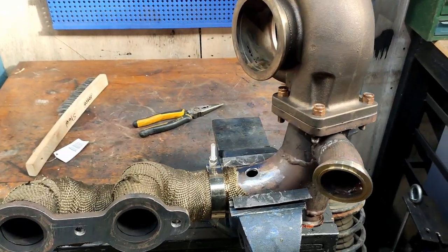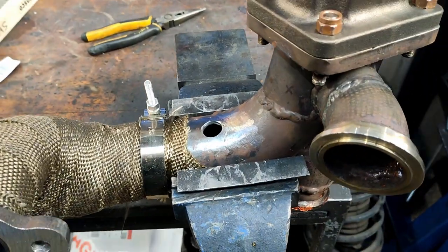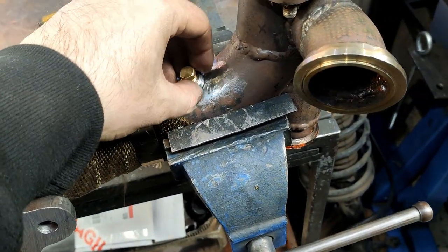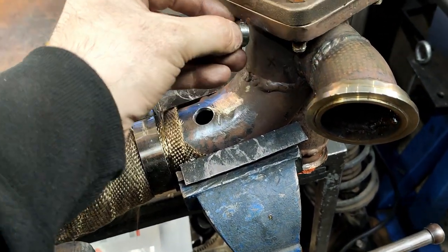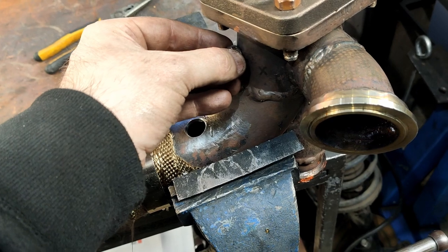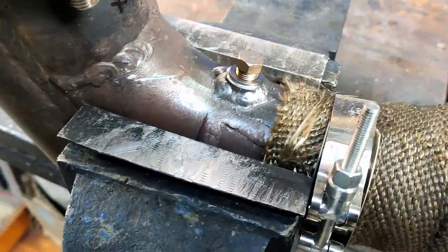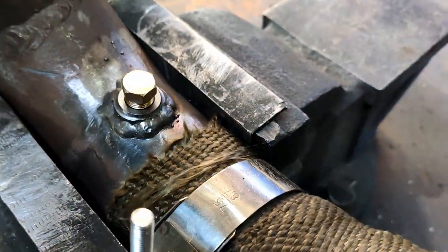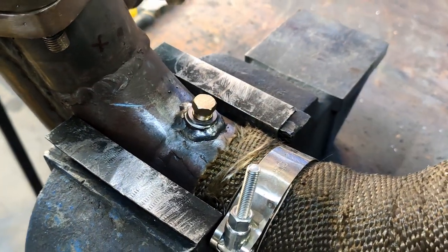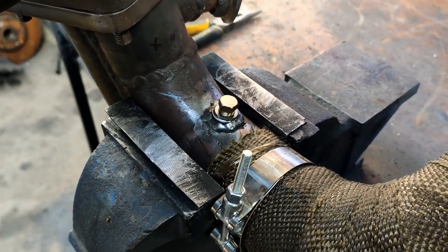One of the problems with having smarty-pants friends is they want me to put sensors in everything and get data for reasons. I'm going to drill a couple of holes in here while I've got it apart — I don't have all the sensors yet, but this will be manifold pressure, and I'll have another one here for EGT. I only need one because I can't trim banks individually, so just the one to see pre-turbo. Job done. I'm not a welder — don't judge me. It is glued together; metal has become one. I don't have the other bung, but it's looking like it'll be pretty good around here, probably not today though.